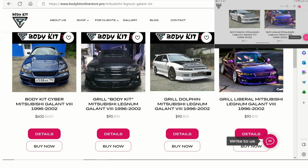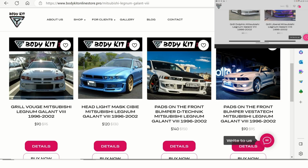These are also grills here. I also want to make a mention, when you do get a grill, you see these headlights, they're JDM headlights. They are longer than the US headlights. I'll get into another video with headlights and grills and rear tail lights. But normally you cannot run a JDM grill with the USDM headlights from what I've read a long time ago. There's just a size difference.